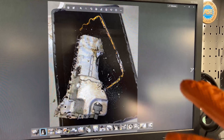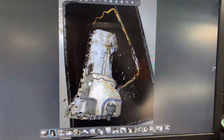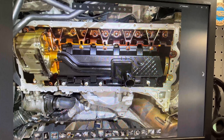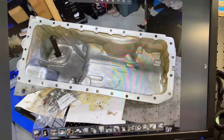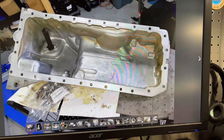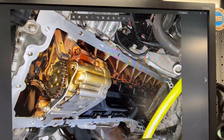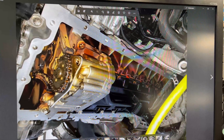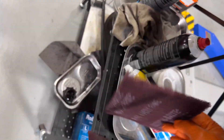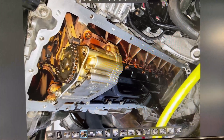I like to do a preliminary cleanup so I'm not working with a fully dirty subframe or part. I take the pan, grab a small chair, and finish cleaning there — I find it really easy. Every surface is cleaned really well. That oil pan after I'm done looks like brand new. OEM bolts — never reuse aluminum bolts, they have to be discarded. For the block surface, don't use anything that will scratch it. I use a 3M very fine pad — that will not make any marks that could cause leaks.